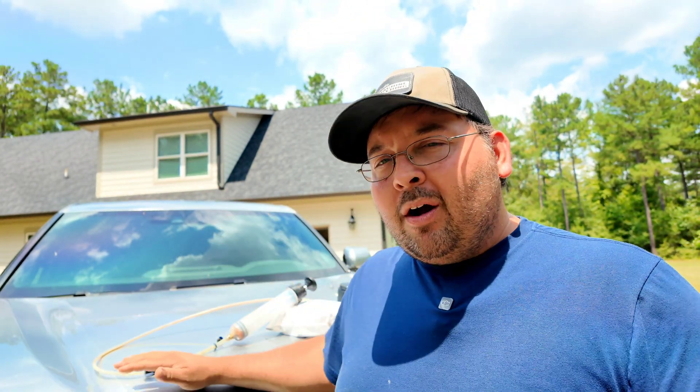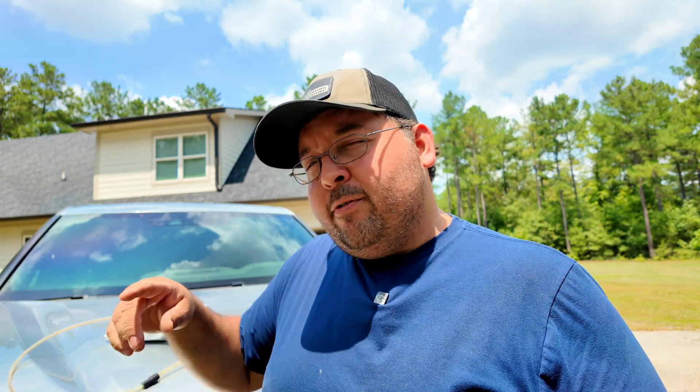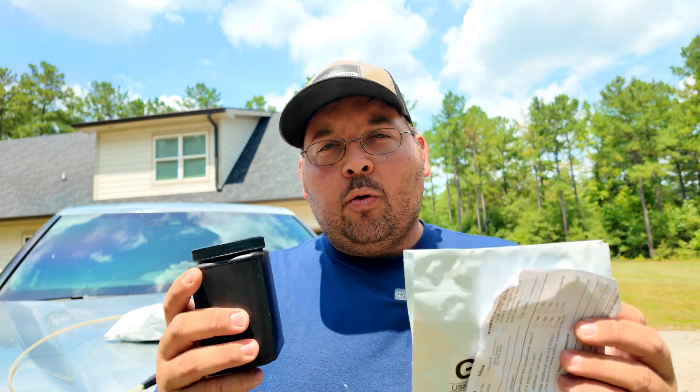We did a previous oil sample on this truck just a few thousand miles ago and now we are at the 5,000 mile mark. These oil analyses actually break down exactly what's in the oil — I did another video I'll post up here, you guys can check it out. Today I'm just going to show you how to do an oil sample to send off. I'm using Blackstone, who I used last time. Blackstone will send you a package and you can ask for however many kits you want, or if you do one sample they will send you two more.